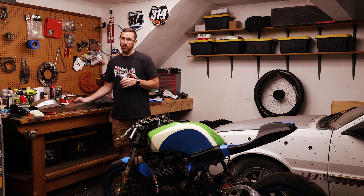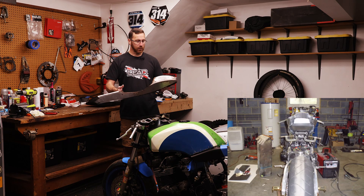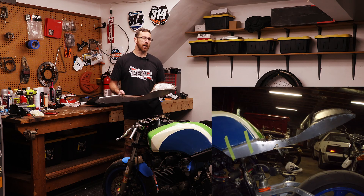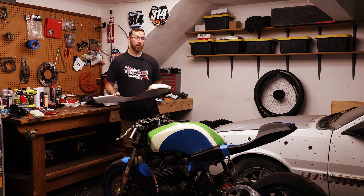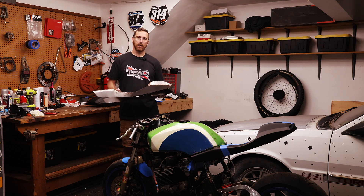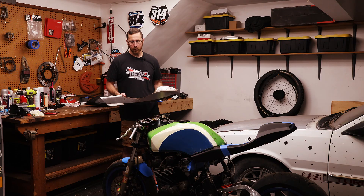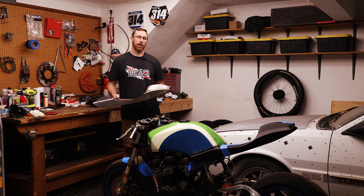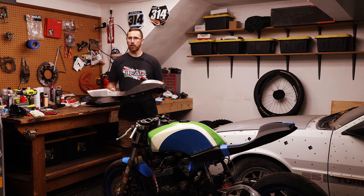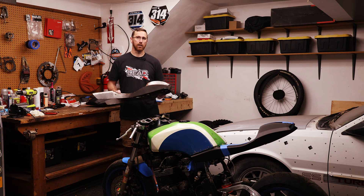This version I originally built in 2010 — the sheet metal base of what I was doing. This was meant to be a race bike at that time. I had visions of doing a vintage series on the bike, which in stock form would be in Vintage 5 — the 750 GPZ and bikes of that era. But because of the suspension modifications, going to 17-inch wheels, six-piston brakes and all the other stuff, it kicked up instantly to Vintage 7, where first gen R1s, the 919 CBRs, and early CBR 1000s — very powerful, well-handling liter bikes — would be in that class.